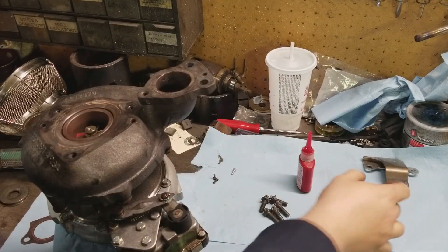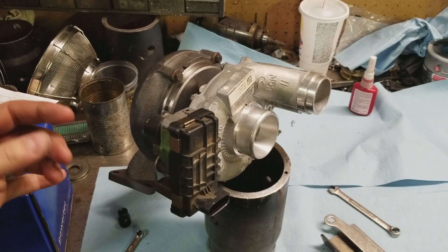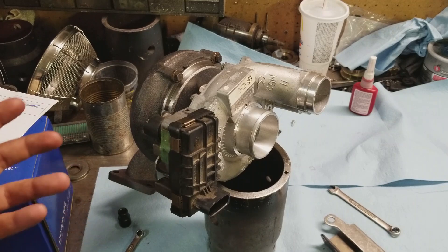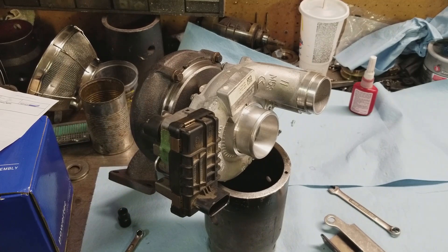The flange that actually holds this to the engine mounts here just like that — and it is done! It's going to look a little different than the earlier parts of the rebuild because the clock for the turbine end was wrong, so I had to redo that. I used my original disassembly pictures to find the approximate clock position and I'll probably have to fudge it a little bit when I put it back on the vehicle. But that's it — it's done. I had a few problems getting it back together, but saved myself about $1,400. It's definitely a DIY job — you don't need any special tools or anything like that. Rebuild's done. Peace!